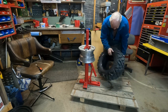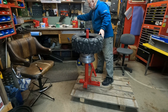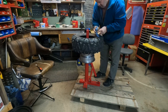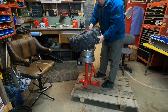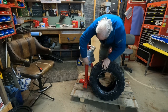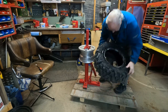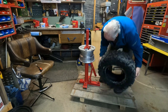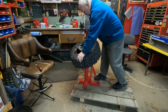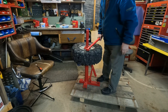Now we're going to mount our tires — these are the Traction Rover tires that I bought. I also made up some water and dish soap to make a nice soapy compound, so I'm going to wet down the beads and hopefully they'll slip on a little better. The sidewall with the white tag on it I'm going to put to the inside. Sometimes they say you can just force these on by pushing them — hey, look at that, so that went on pretty good.